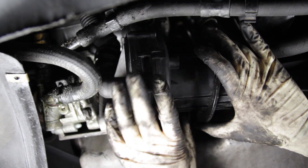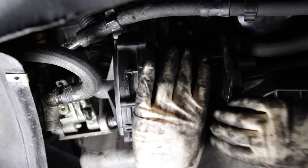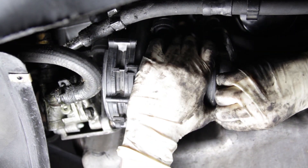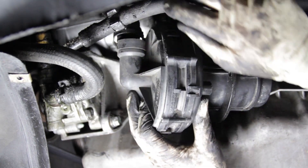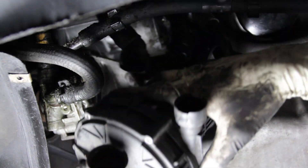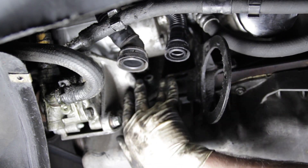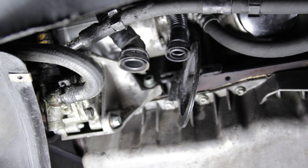We've loosened all the bolts on the lower part and we've taken the two 8mm Allens on the bottom out. We've loosened the top 8mm and we should be able to just fish this out of the way — you may have to turn it and rotate it down. There are two bolts here and here, and we just have the top loose. We have not removed the top bolt. If you do that, you'll probably have a really hard time getting it back in.